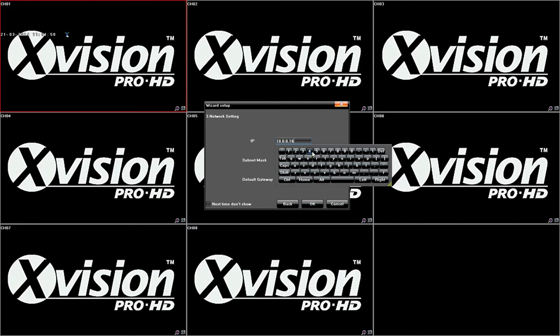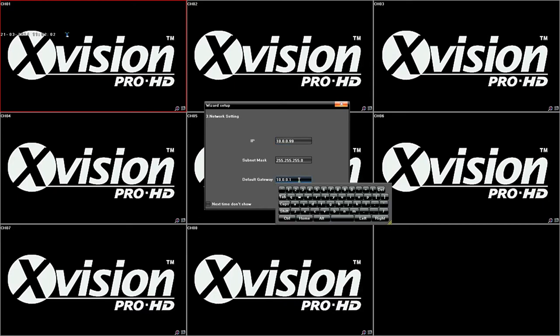Obviously language is set to English. The next option is your monitor resolution, which you can select there. The next screen is your IP configuration where you set the IP address of your recorder. Make sure it is well away from your computers — make it 10 away, because that will then change the IP addresses of cameras to 1 above that. So you set your IP address; I am putting 99 there. The subnet mask will be the same as your network settings and this will be your router IP address.